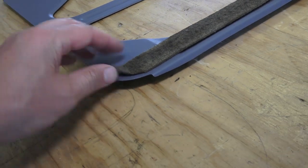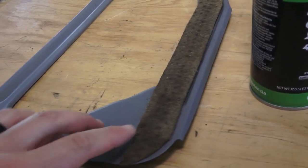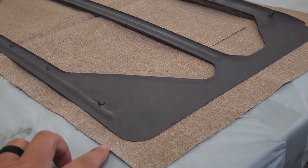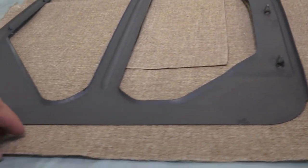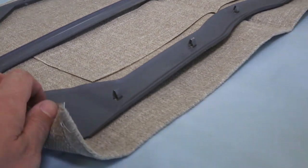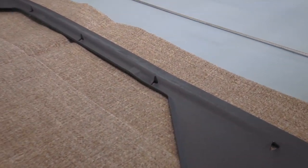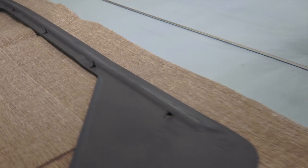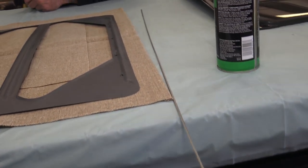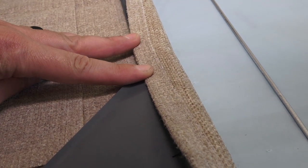The last piece of the headliner is a center square piece. Put the foam pad with the jute material — which came on the original car and we saved and reused — glued back down. The aftermarket piece was too big, so now we glue the headliner down to the center and pull it tight all the way around. There's a section on the panel with spikes, and the headliner has a pocket tube where the headliner bow will be inserted — make sure you save that during teardown and reinsert the bow through the pouch over the spike.